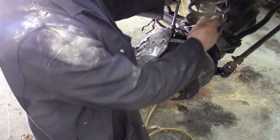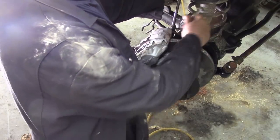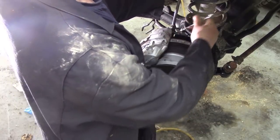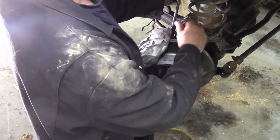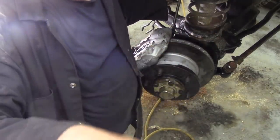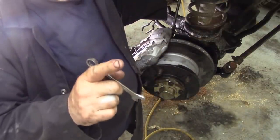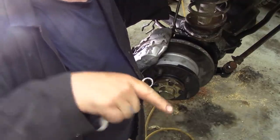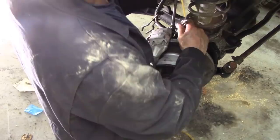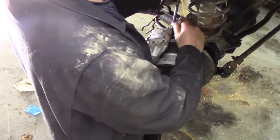Now, I don't know if it's on these, but a lot of hydraulic pipes have got a stripe on them, and that's to signify that it has a potential twist in it. So the stripe should be straight, the run of the pipe should be straight, so that's what the line's for. Now if you've got any twists in it, the line will go like a spiral, because that's what makes the pipes short-lived, if you see what I mean.